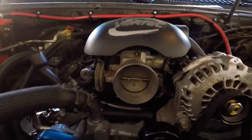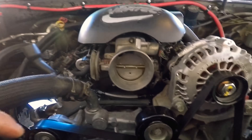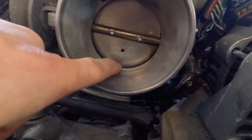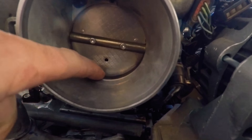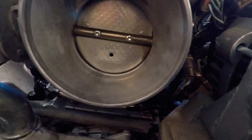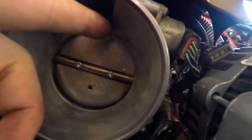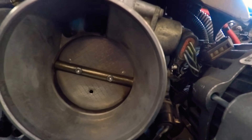I'm a little upset this one won't work with my truck — well it will, but it won't bolt on. I figured I have two, so I'm going to take this one off and send it to him. He only charges $45 to port it, and that is a hell of a deal. Right here there's a lip — it's actually smaller before the butterfly — so he removes a whole bunch of this material to increase airflow.